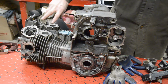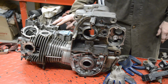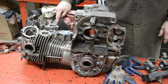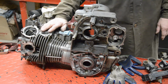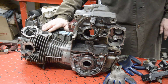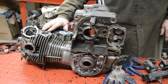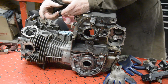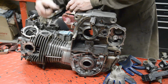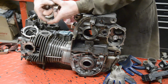The other thing we're going to do is, because, as I say, this frame is basically identical to the XT, the frame tubes are going to come down and foul having two carbs. Now, there's two possibilities here. We'll make this final decision when we get the engine in. The normal carbs on this engine are CV type. They're a diaphragm carb. So on the top, I haven't got one to hand, they have a big square diaphragm. Whereas your carb is normally narrow, a slim body, they're a much chunkier carb and they have this big square thing on the top.